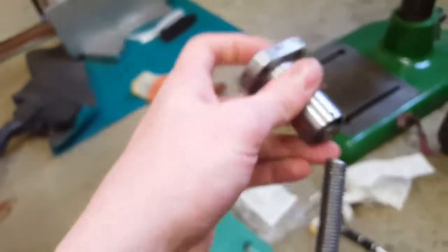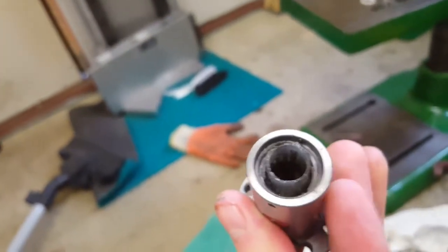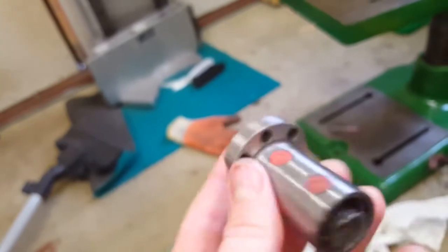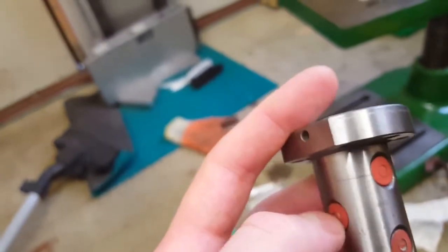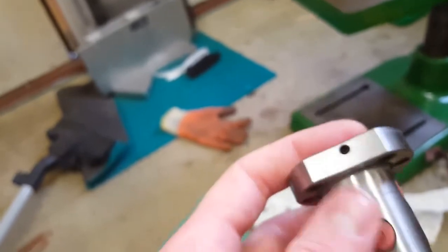So if you were just to put this on and fill it up with ball bearings, you're actually going to end up filling up a lot of those unused rings which don't do anything — they just come up to the back of one of these lugs and get jammed in there. So you'll end up just rubbing and rubbing the ball bearings around.